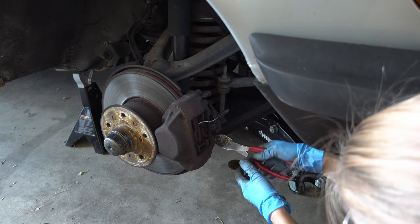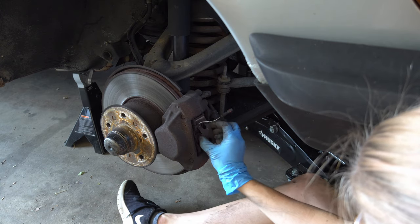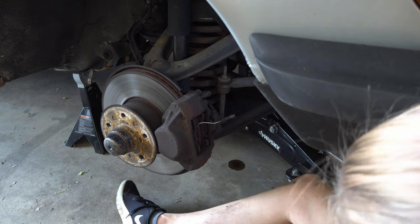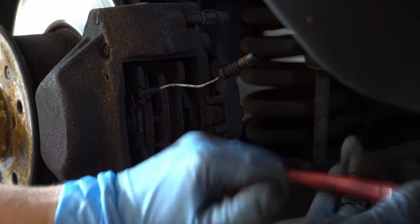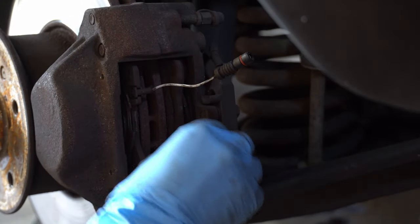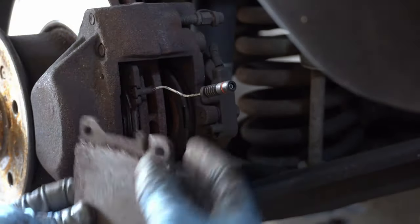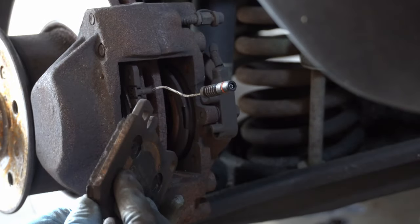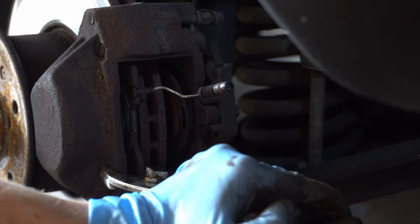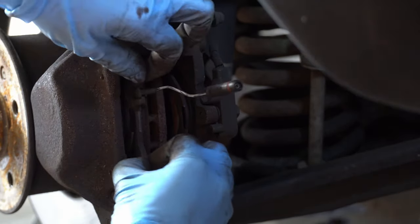Now pull up those pins. Unfortunately, the spring tension of the pins popped out the metal plate that holds in the brakes, along with one of the brake pad sensors. You might have to use some pliers for these, so just be careful pulling those out. From here, we'll compress one of the pads against the caliper by using the caliper itself as a wedge — squeeze those together and it'll move that piston back so you can shake that brake pad free. We'll repeat that same process on the other side; don't be discouraged if you feel different tension from one side to the other.